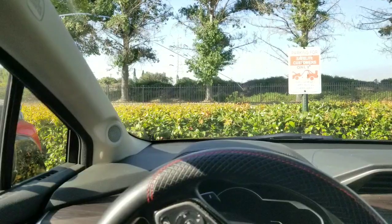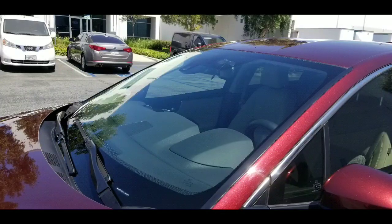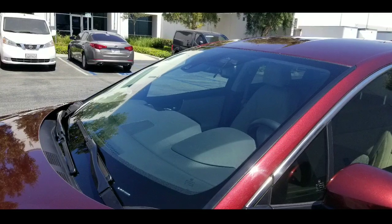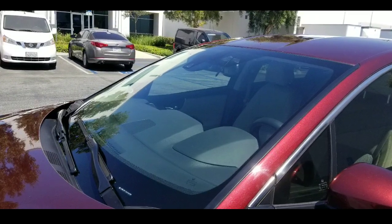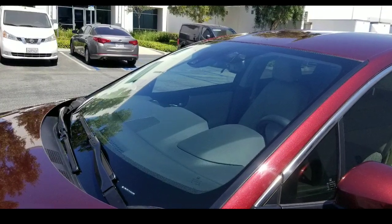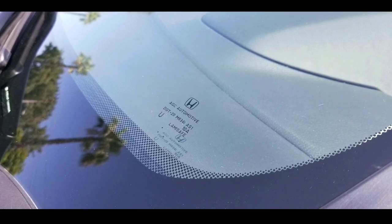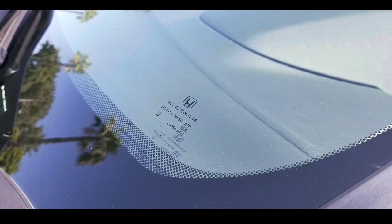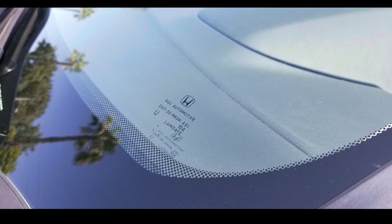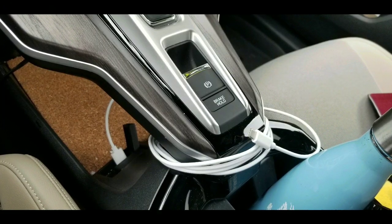Keep three or four layers at once and seesaw it off. The reason I did this was a big crack on my driver's side — I wanted to keep the mounts and put them on the new glass. This was a Honda Clarity, and most new cars have laser and camera systems mounted on the windshield that require OEM glass and recalibration at the dealership.